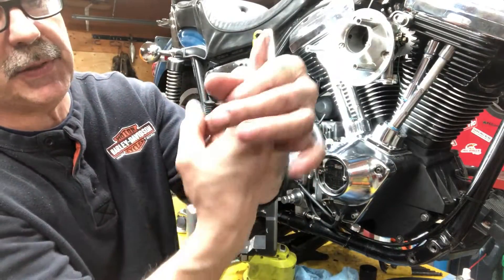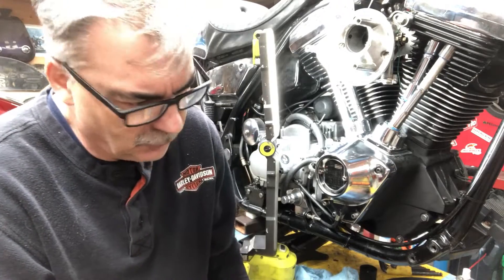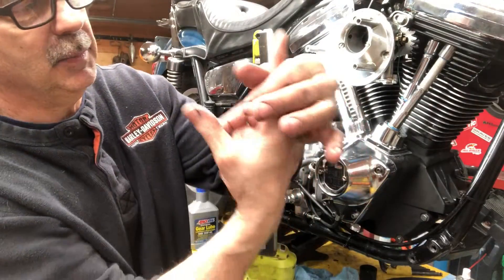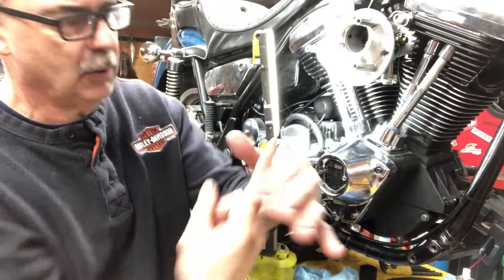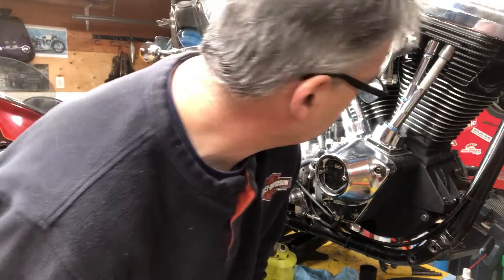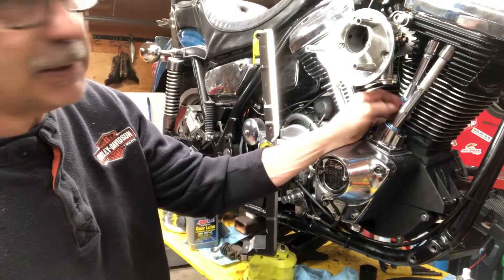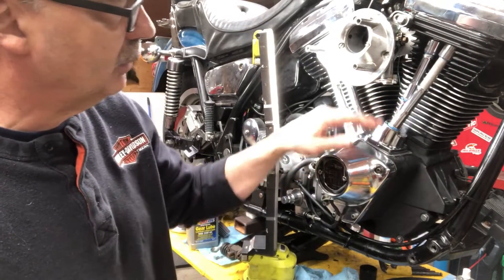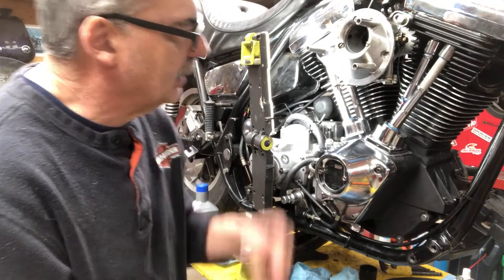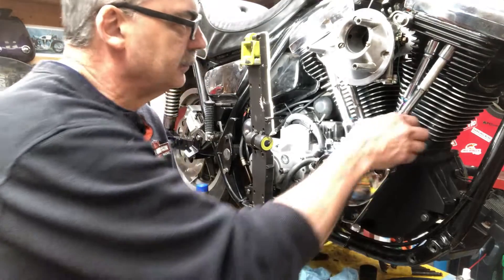So that hydraulic lifter is like a little hydraulic piston with a spring and oil. It has some travel — maybe half an inch or three-quarters. You want to turn it so it's in the middle of that stroke, like a shock absorber. You don't want it at the very top where it'll be too loose, and if it's at the very bottom it's going to be too tight and bottom out and bend the push rod. So you want it in the middle of that stroke. Right now turning it is squeezing the oil out of the lifter — that'll become a lot looser in probably 15 minutes when it squishes the oil out. I'm going to go to the next one.